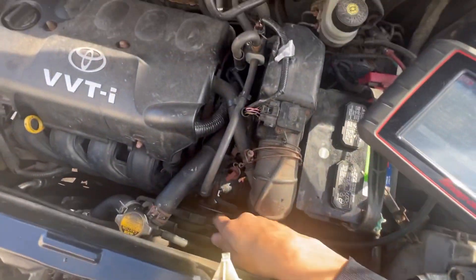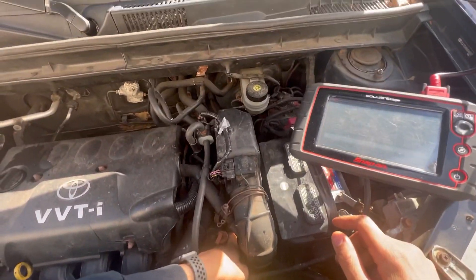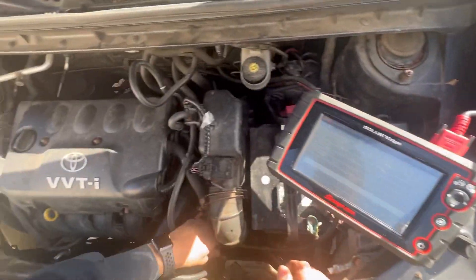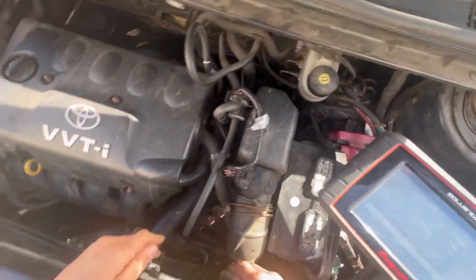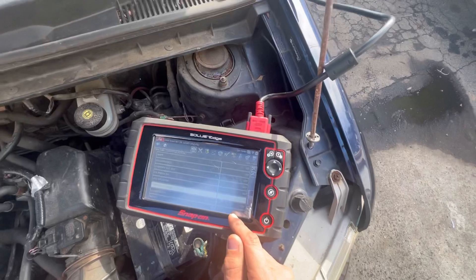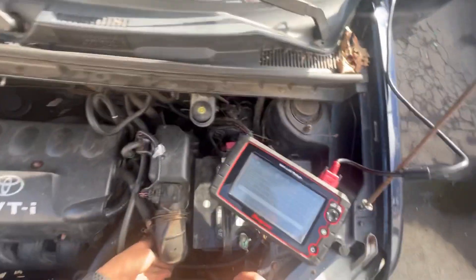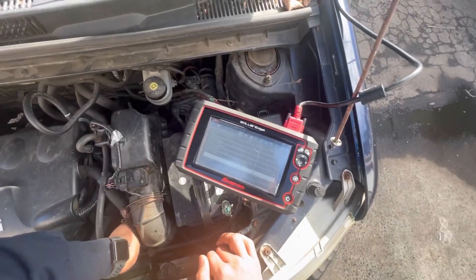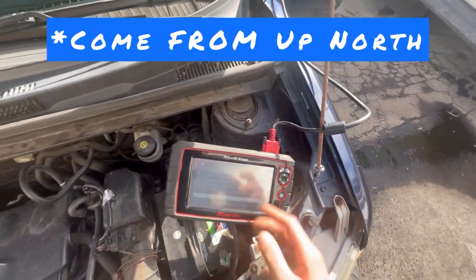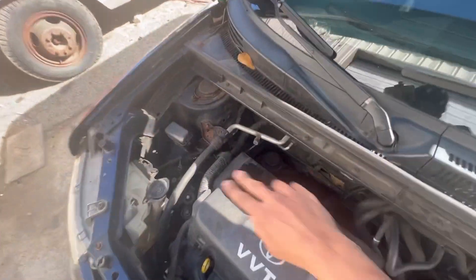This is a cable-driven system, not drive-by-wire, and the throttle position sensor sits right down in there. I'm going to wiggle the wires now to see if the reading comes back. Look at that — it just went down to 12% and all I'm doing is touching the wires. So I'm guessing it's corrosion around the plug. This car came from up north, so there's a lot of rust and oxidation going on, especially looking at the terminals — the shock tower is rusted, rust everywhere. This car definitely spent some time up north.